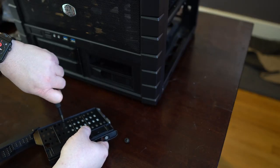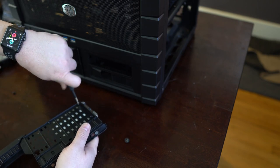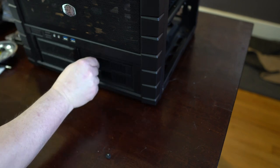Some other suggestions are to add a USB Type-C port to the front I/O, make the two included fans PWM, wrap all front I/O cables so we don't have to deal with any ketchup and mustard, improve the toolless hard drive installation to better accommodate 2.5-inch hard drives, and make it so we can morph the 5.25-inch cage slots to hold additional hard drives should we not install a 5.25-inch device. Finally, should an update also have a solid top panel version, make it tempered glass and not acrylic.